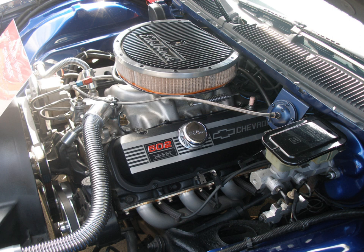The theory behind this arrangement is that maximum brake mean effective pressure is developed at relatively low engine speeds, resulting in an engine with a broad torque curve. With its relatively flat torque characteristics, the W engine was well suited to propelling both the trucks and heavier cars that were in vogue in the USA at the time. The W Series was a physically massive engine compared to the small block Chevrolet, with a dry weight of approximately 665 pounds, depending on the type of intake manifold and carburetion systems present.